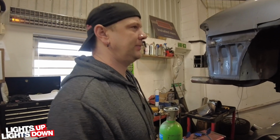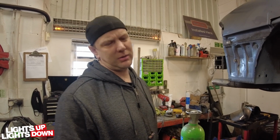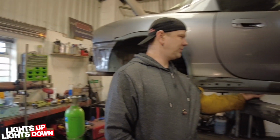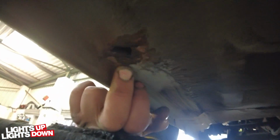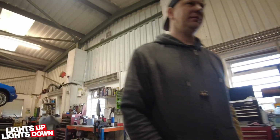All right. Nothing else to add to that then? Not really. I suppose a bit. Oh, I've got a bit of floor pan hole to repair, just there. They normally go on the seam where the two sealed floor panels meet. It's just that one has blown through. So we'll cut all that out and rebuild that.